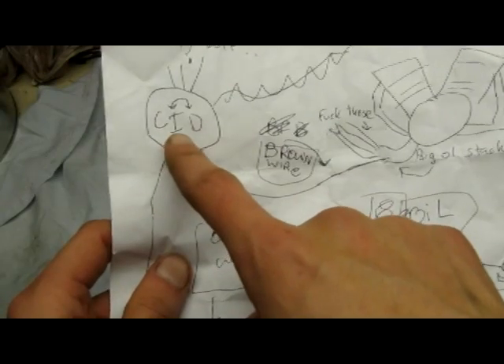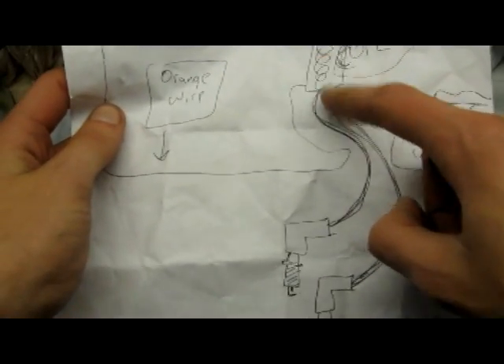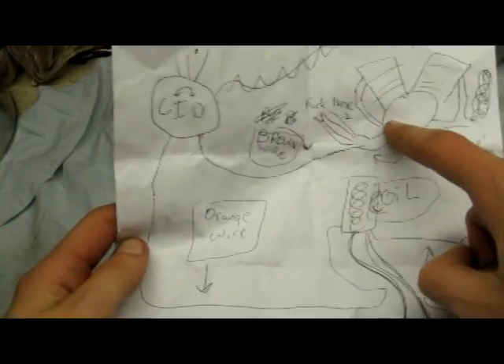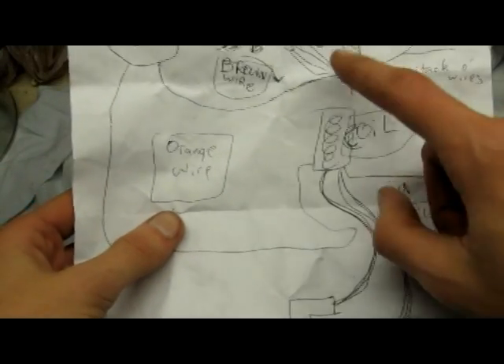Once we determine the charge wire coming out of it, we find the corresponding CDI wire, which in this case was brown. We connect those two up. Then we go to the coil, find what color wire the coil has, and connect those two, connecting the CDI. Those are the only two wires we need to connect through the coil, CDI, and the magneto. Then the one from the coil, we need to ground it. We ground it to the snowmobile, and if all connections are proper, we should get spark to our spark plug.